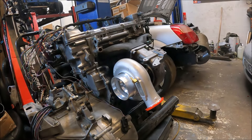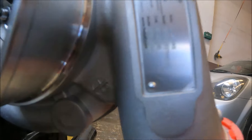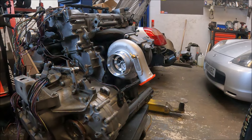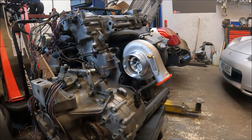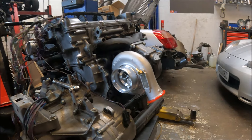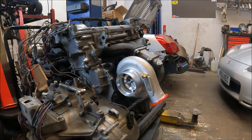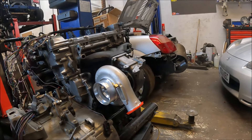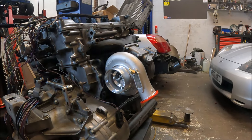The wheel makes more of a difference than the housing, so let me talk about it a little bit. This is technically, according to Holset at least, a HE351. It's not like a typical HE351. There are HE351 CWs, which were only on a certain kind of Dodge Ram back in the day — they're like a HY35 rear end and a HX40 compressor side. Ignore them because they're good turbos but nothing like any other HE351. Most HE351s these days are HX35/HX40 hybrids.